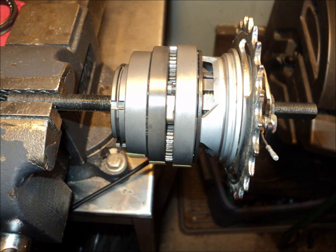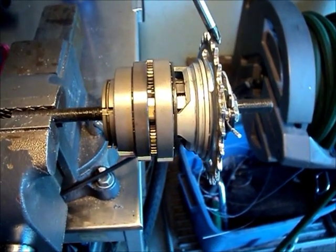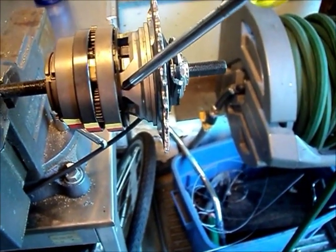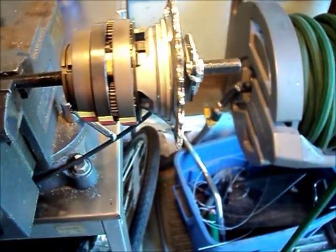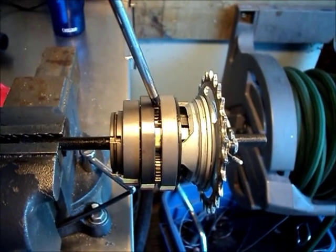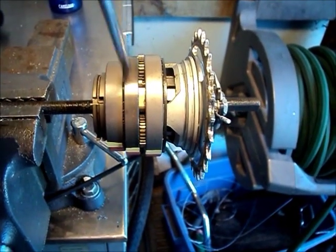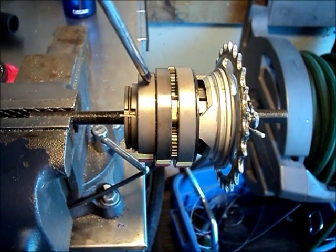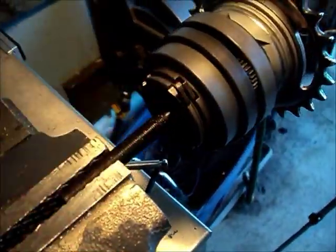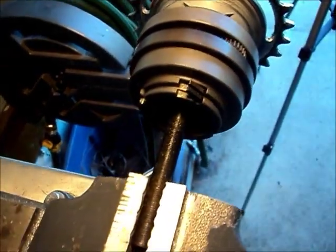Here's the unit out of the hub shell, and here's the hub shell interior shot. You can see the ratchets on the far side there that engage the pawls and drive the shell. Various parts: the input driver, which is in direct connection with the first stage planetary gear stage, which is hidden by the second stage ring gear. The second stage planetary gear set is partially covered by the third stage ring gear, and the third stage planetary set is covered by the final drive output ring gear, which is part of the same unit that houses the output drive pawls — spring-loaded pawls that transmit the power to the ratchets inside the hub shell and propel the bike forward.